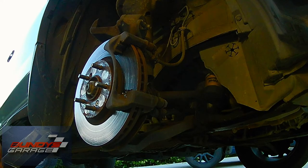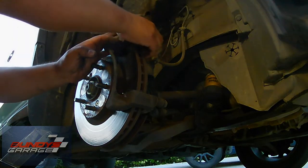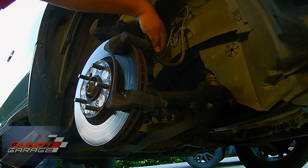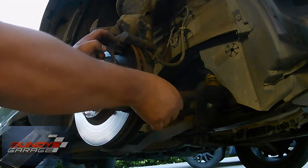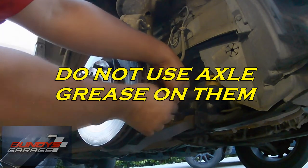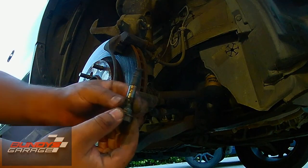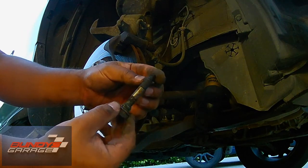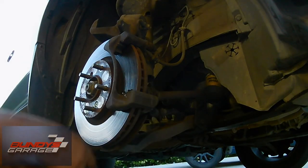The most important part is making sure where the brake pad slides is greased up. I also want to grease the slide pins. Let me pull one out — it's really stuck in there, which means it's been on here a long time. The reason you want to grease the slide pins is that unevenly worn brake pads are almost always caused by nobody taking the time to pull these pins out and grease them. Clean with brake cleaner, add new grease — Bosch grease or Siliglide — make sure the rubber boot goes back on, and reinstall.